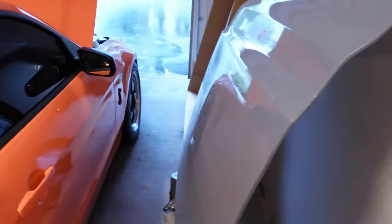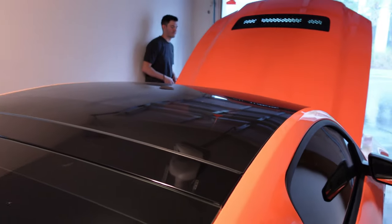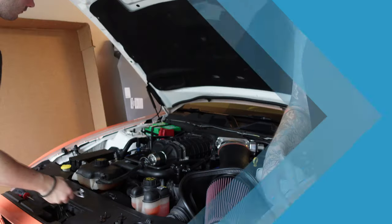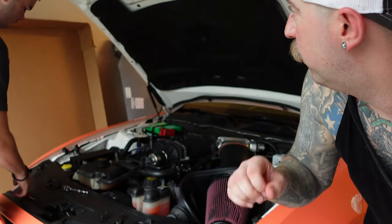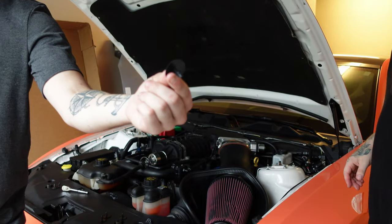Let's take a look at this hood. Right now I just got it up against the wall. Me and Austin are gonna take off the OEM hood that's on the car. We're gonna start this install on the hood — I'm gonna give you guys a step-by-step because I haven't really seen many on the Savini hood. First up, we're gonna take all these clips out — there's like 14 of them.